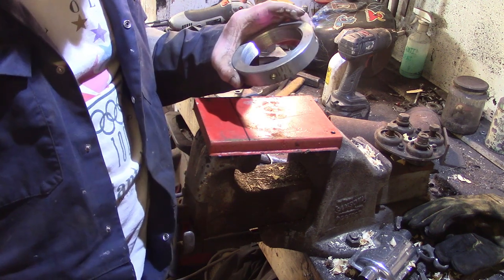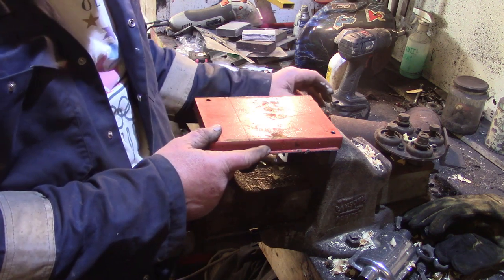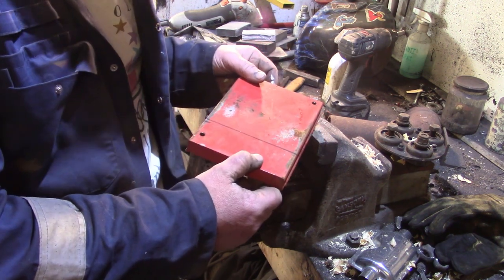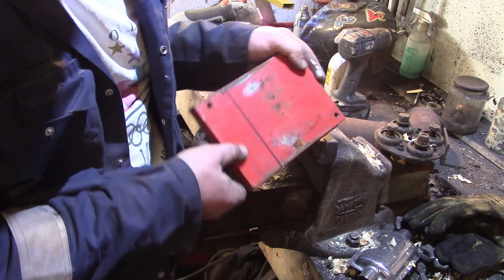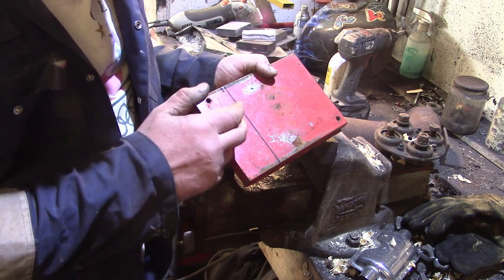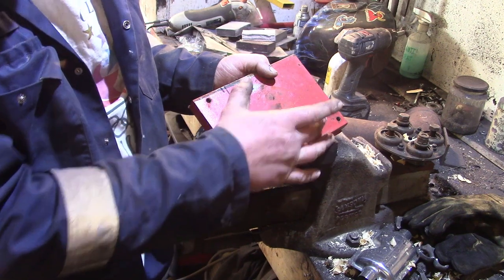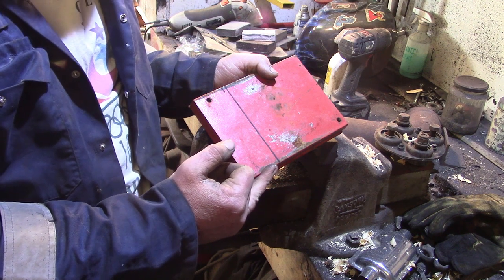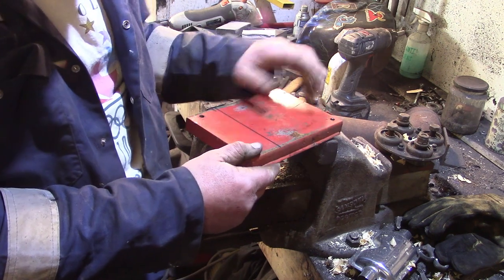But either way, with this off, I was looking at, rather than chain drilling it, because that would be a little bit boring, getting it in the lathe. Unfortunately, my lathe isn't the biggest. It's small but perfectly formed. Either way, I couldn't get this whole piece of metal in, so cutting at that line and using this piece would be the maximum I could fit in the lathe, which I've now pretty much decided to do, because that will give us a nice clean bore.